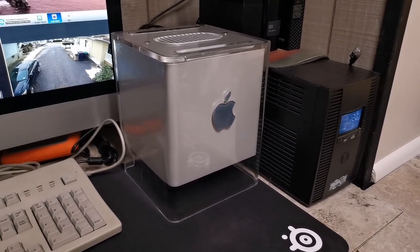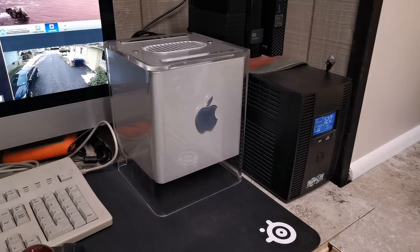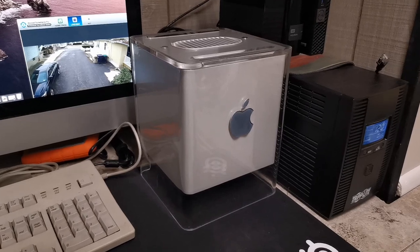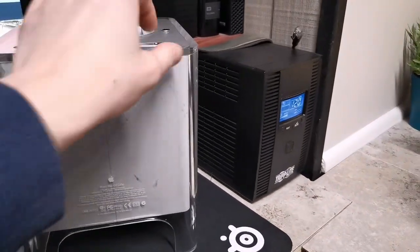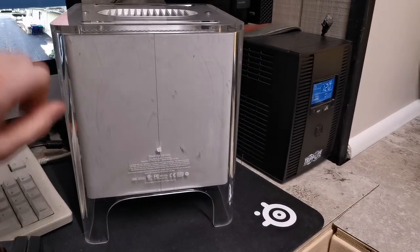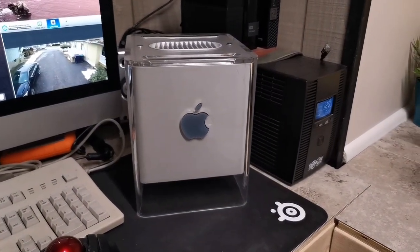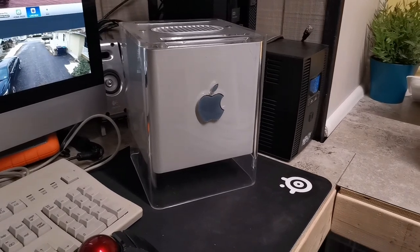I enjoy this Cube so much. This, by the way, is a 500 MHz. I bumped it up from 384 MB of RAM to 768. It's running macOS 9.2.2, my favorite classic macOS, and it runs great on the G4 Cube. I thought it ran pretty well on the iMac G3, but on the G4 Cube it's even better, just because it's a faster processor. I swapped out the hard drive — which was a 40 GB, maybe a 30 GB IDE drive — for a 120 GB SSD. I backed up my iMac G3 and I want all of that on the G4 Cube; I just haven't gotten around to doing it just yet.